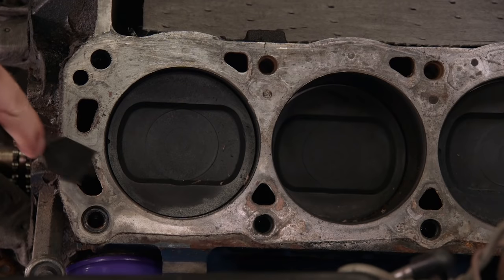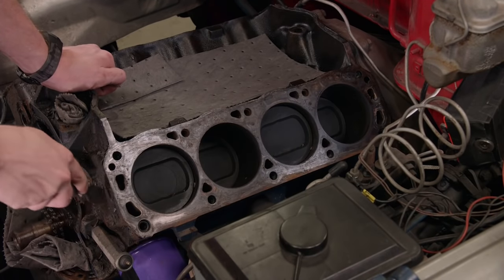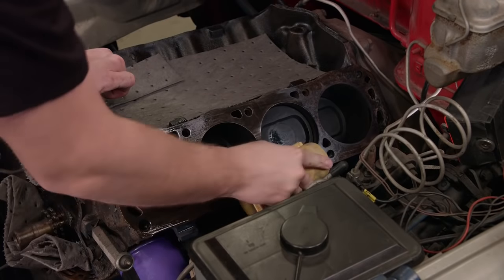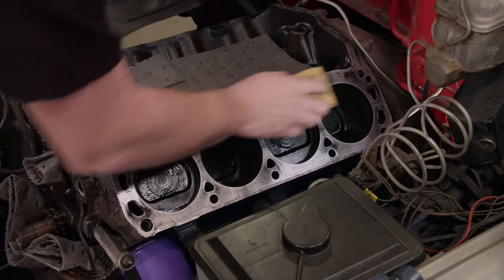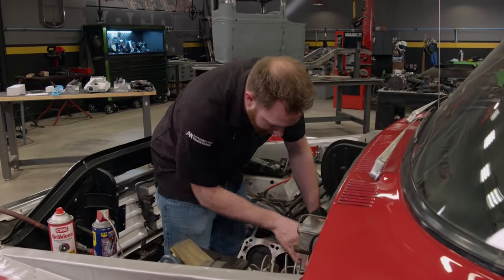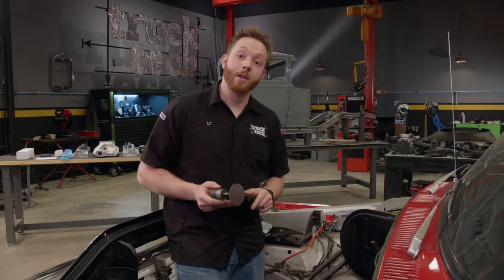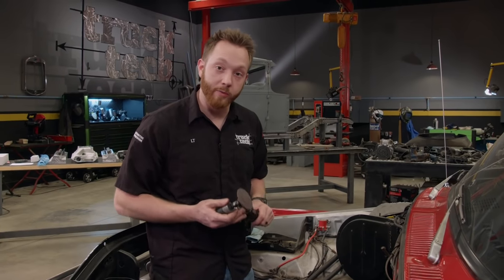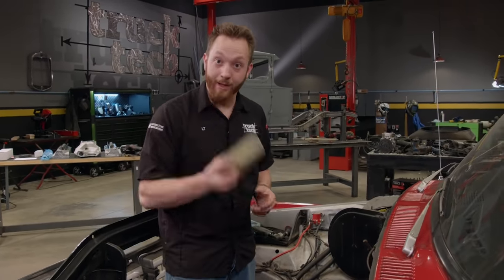We need to clean up the deck surface to prepare it for the new heads. We'll start with a metal scraper to remove all the leftover gasket chunks and rust, then soak it in WD-40 and use a rigid sanding block with 180-grit paper. We'll wipe it down with brake cleaner and make a final pass with more WD-40 and 220-grit. When it comes to cleaning up a block, guys often reach for a red Scotch-Brite on an angle grinder. There's no question it'll make quick work of the job, but these are actually very aggressive and they'll take away a lot of material — often unevenly — which can lead to head gasket sealing issues. This is one of those instances where quicker isn't always better, which is why I like to do it by hand.